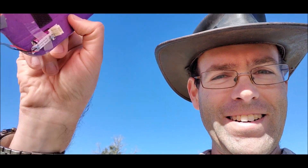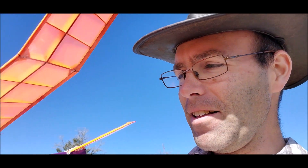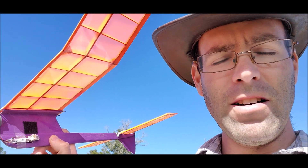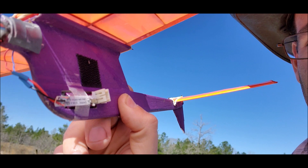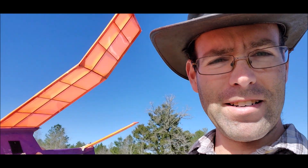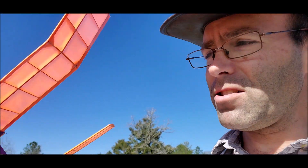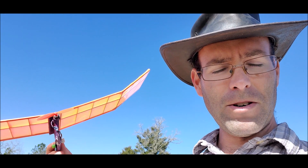What it wasn't designed around, though, is that gizmo right there — it says J&H Aerospace on it. This is a capacitor charging board — an ultralight charging board — so it adds no measurable weight to your airplane, like 0.5 gram at most. It has a JSTPH connector built in, and a tiny little switch. It works awesomely. The airplane has a slot that the capacitor slips into, and you can bend the connectors on the capacitor around so that the board mounts in there very nicely. We do supply this soldered up to the 8.5x20 motor. That's a new gizmo available on our website.